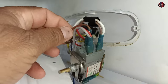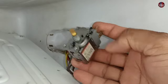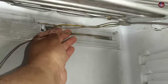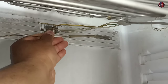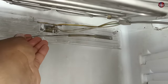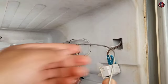Now I will disconnect all the wires of the thermostat. Next, I will carefully remove the capillary tube from the refrigerator using a technique. I could cut the extra capillary tube, but to remove the thermostat with a complete capillary tube, straighten the capillary tube first — it will then be easier to remove. Push the thermostat to guide the capillary tube out of the refrigerator body. If the tube gets crooked, it will come out with force, so straighten it while pulling. Now the thermostat is out with the capillary tube.